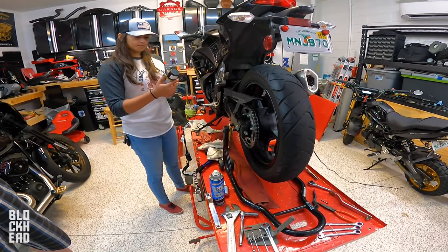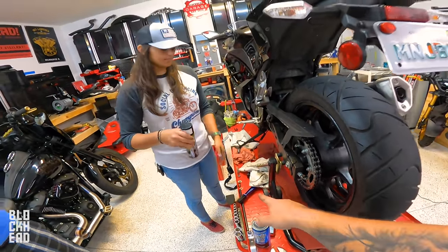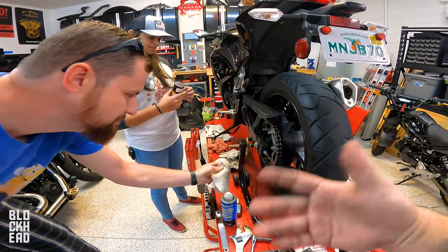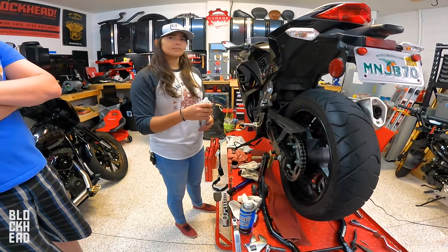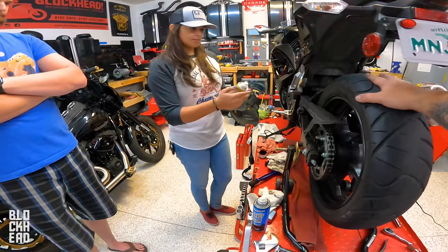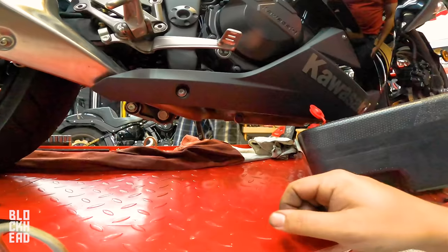On a note about the stuff we're using — if you guys are interested in any of this, check out the links down in the description below. We'll drop links to chain cleaner, chain lube, the brush. We'll just link to Amazon for now until West Depot is up and running. With the lube, you pretty much just want to apply a coat — not too light, but not too heavy either. Go too heavy and it's gonna be dripping all over the place. After we apply this you have to let it set for a bit since it is a wax-based lube. One of us will spin as the other person applies.